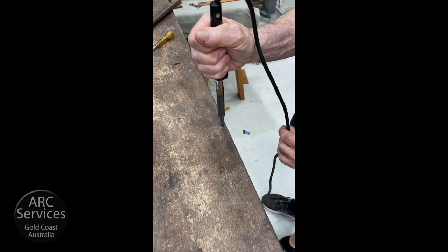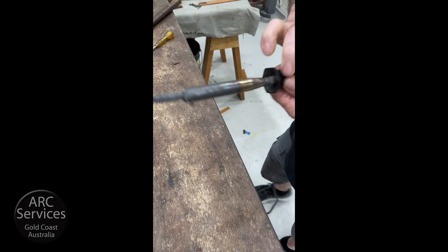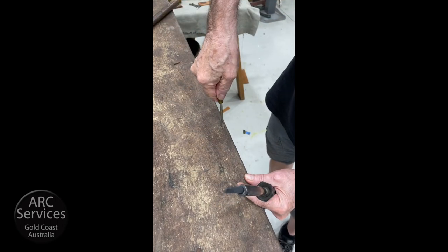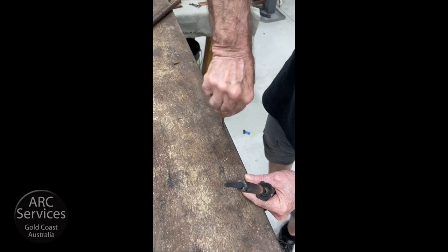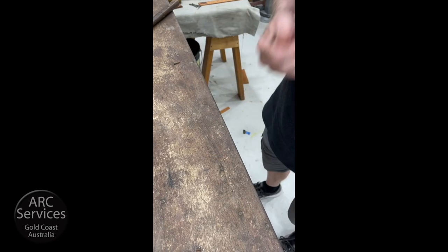This is quite a good tip for getting screws out. These screws have not been out and are really securely fixed in there. So you take a soldering iron whose end has been turned into a screwdriver. Whilst the screw is warm, it can be undone quite easily.